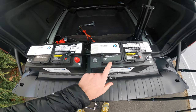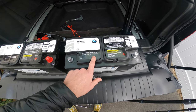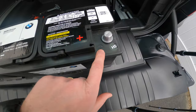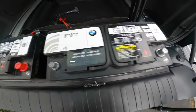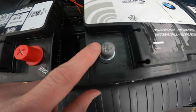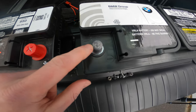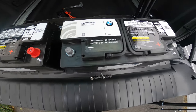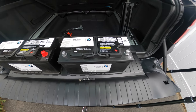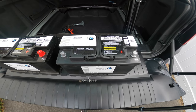Here's the new battery and here's the old battery. To date a factory BMW battery, it's pretty easy. Look for the minus sign — that means negative terminal. If you look closely, you'll see a 3-0 and a 1-5, which means this battery was manufactured the 30th week of 2015. So this battery is currently seven years old — definitely at the end of its life. Really shouldn't let a battery be used in the car at seven years old; usually it's closer to five or six.